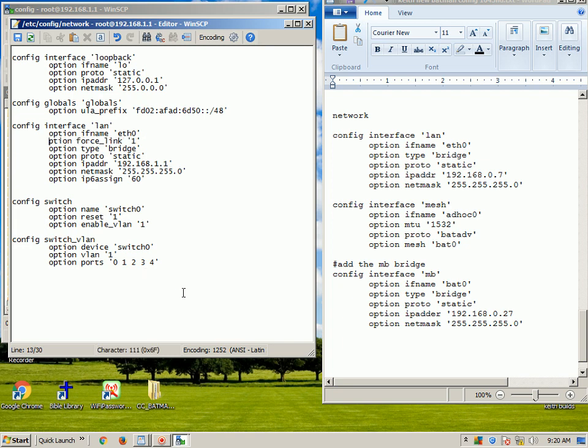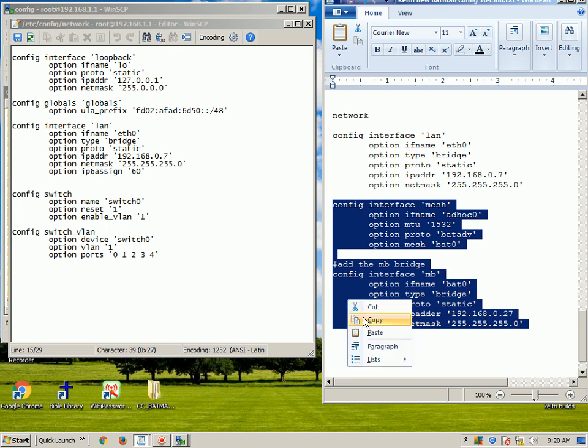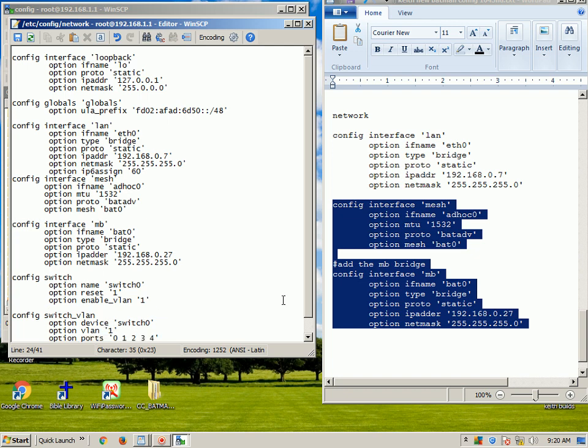Okay, that's right here. We're going to change it to 07. And down here it'll be 27. Okay, 255.255.255.0. And I'm just going to copy these right here and drop them in. Don't need that, so I'm going to take it out of there. Alright. So that's pretty much it. Okay, save that.